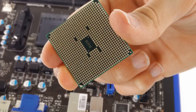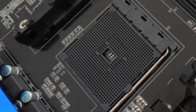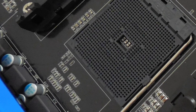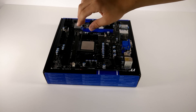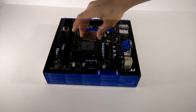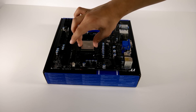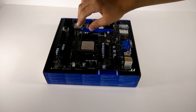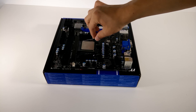Find the golden triangle on the corner of your CPU and align it with the triangle on the socket on your motherboard. For AMD CPUs, align as stated with the retention arm lifted up, and the pins on the CPU should simply slot right into the aligning holes on the socket — no force is needed at all. You do not want to bend any pins. If it aligns properly and the pins are slotted in nicely, lower the retention arm and clip it under the notch.